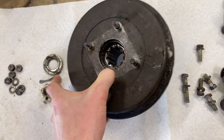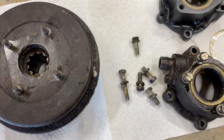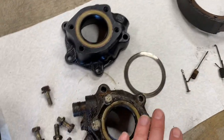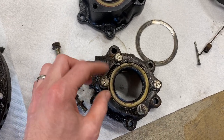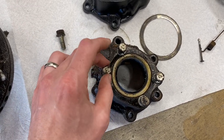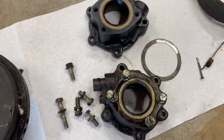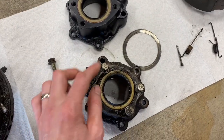You can see this is really caked in grease. Once you take that off, you'll actually encounter the brake backing plate hardware. I just unbolted the whole thing and disassembled it afterwards. You'll encounter four 12 millimeter bolts — someone's been into this transfer case before and used some 13 millimeter head bolts, which is always a joy. Undo those four bolts from the back of the housing and the whole parking brake backing plate comes off. It's up to you whether you want to disassemble the brake hardware before or after you take that backing plate off, but it's only held on by four bolts.